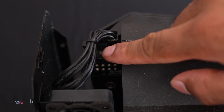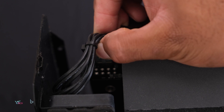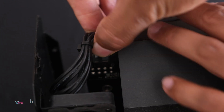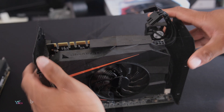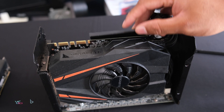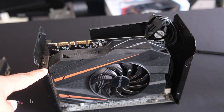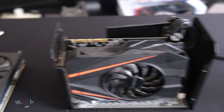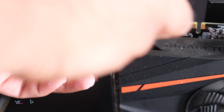To remove the power cable, press the latch at the back of it, press and wiggle and pull up. You will now have the power connector out. There is also a piece of cardboard in here that has some glue on it that you just need to lift up gently. The next step is removing the back screw — all you need to do is remove the screw. Please keep this safe.